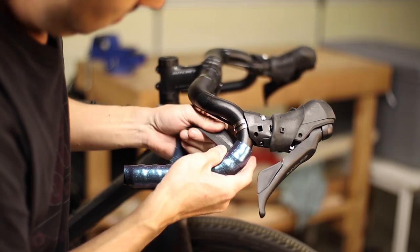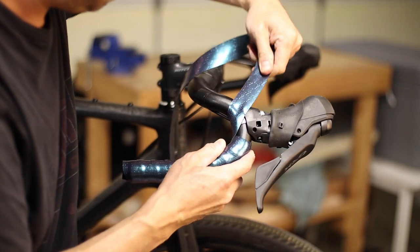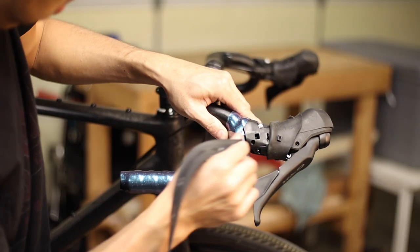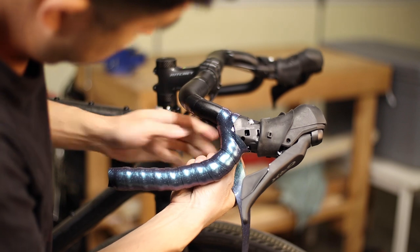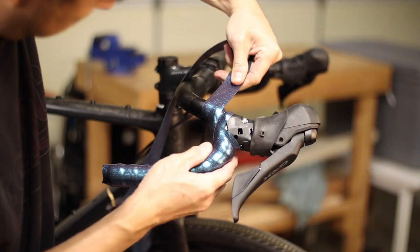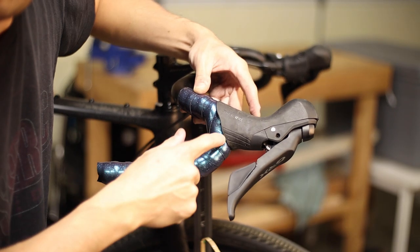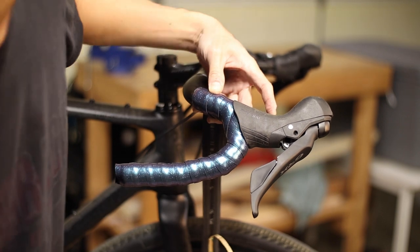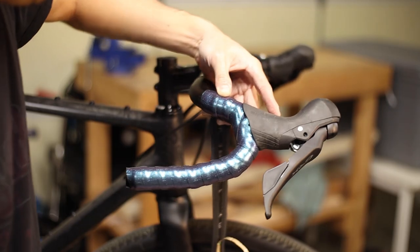At this point you're going to begin the figure eight by going around the front of the drop, back through the drop, and upward over the top. Then back down through the drop, around the front again to close the gap on the handlebar, around through the drop one more time, and over the top. At this point you're finished with the figure eight wrap. If you did it correctly you shouldn't have any gaps in coverage, with the rubber hoods rolled back down, and the direction of the bar tape should be forward toward the front of the bike as you come over the tops of the handlebars.